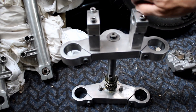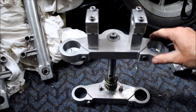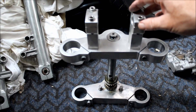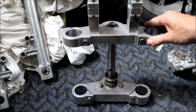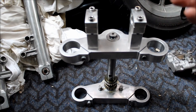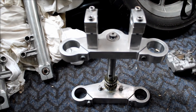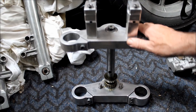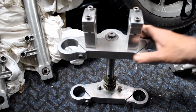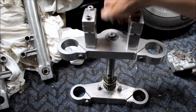Here are those yokes off the bike — hopefully they can be fitted to the Z650 project. The stem is the wrong size but that's okay; we can press that out and fit a different stem if need be. The risers are going to be far too long for that bike, but again it's not a great problem — we can make new ones, shorten these, or find something else. As for whether these will be polished, anodized, or just painted black — I don't know yet. We'll have to see how it looks when it's on the bike. But that won't be happening for a long time yet because this is supposed to be a 2020 project.